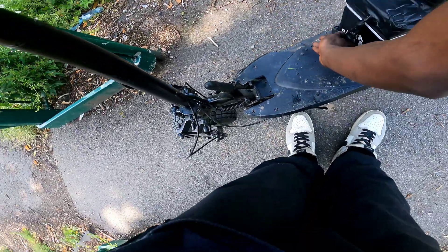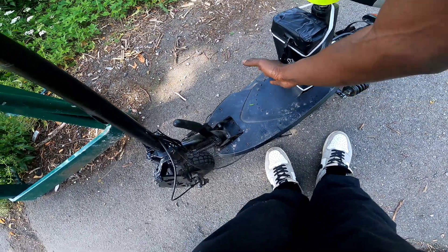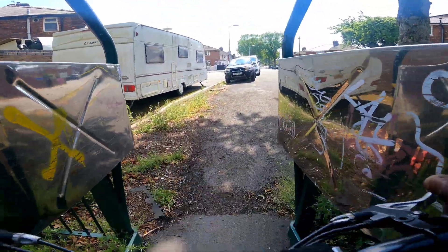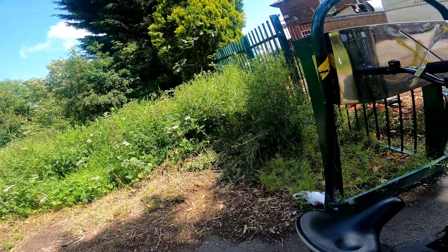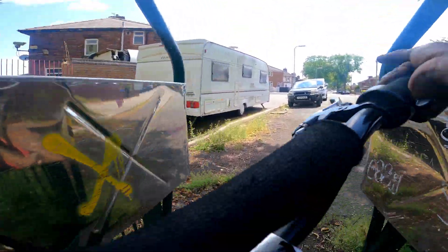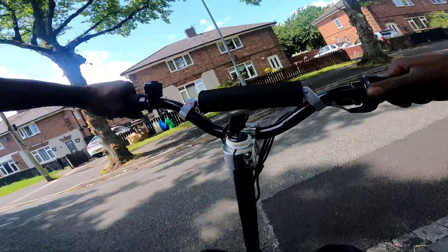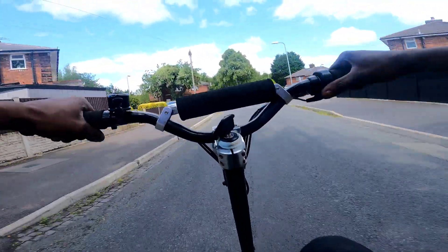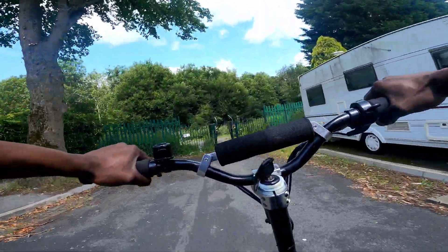Checking the wires again — they're warm. I think I'm going to need a thicker gauge wire for the main battery leads because they're a bit warm, not hot but warm. I'll sort that out. It's quick to accelerate — very quick to accelerate. I'm looking to change either the rear sprocket or the front sprocket to make it a little bit faster by changing the gearing.